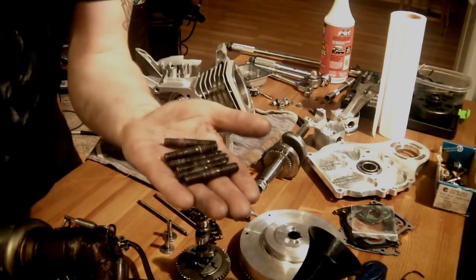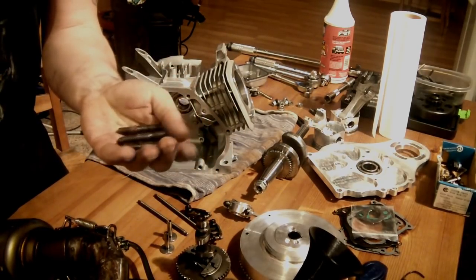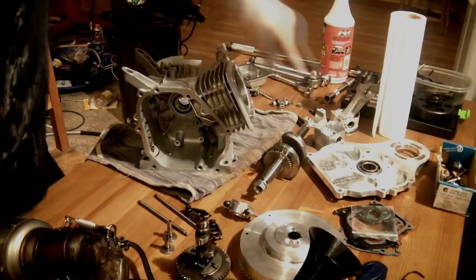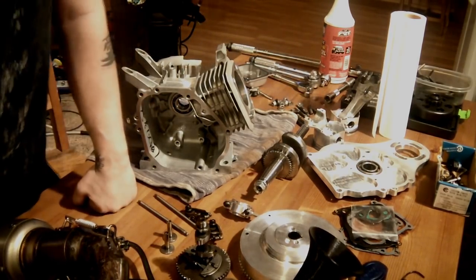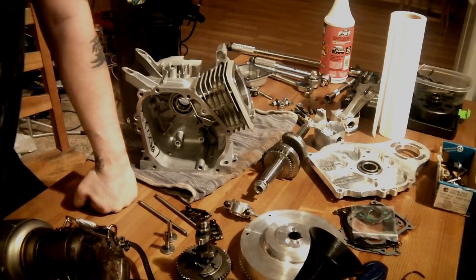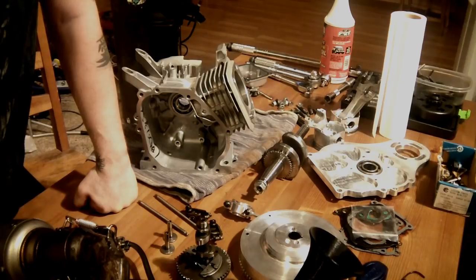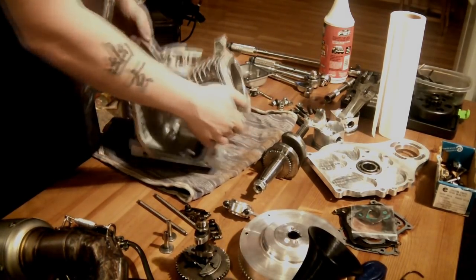I also have a stud kit for the front of the engine case to hold the front cover on the engine case for the same reason. I have actually had the stock bolts come loose one time during flight — that was one of my engine outs. What ended up happening is I spilled all my oil while flying, then the engine started to vibrate and stalled, and I had to do an emergency landing. Nonetheless I would rather not do that.